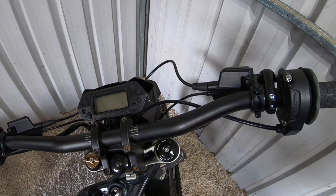The first one I'm going to show you is the brake sensor. With no motor cut-off, it's 8 short pulls, 1 long. For a motor cut-off, that's 9 short pulls, 1 long. That just means: are you able to accelerate with your brake on? You can want to do burnouts, whatever.